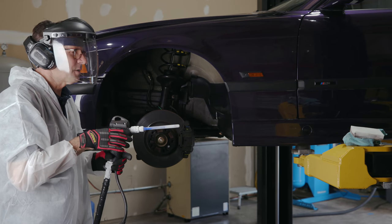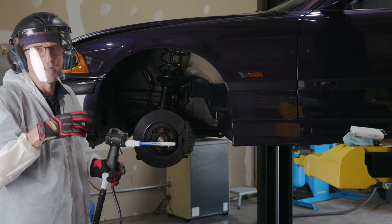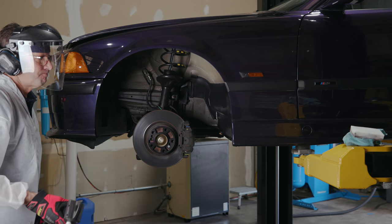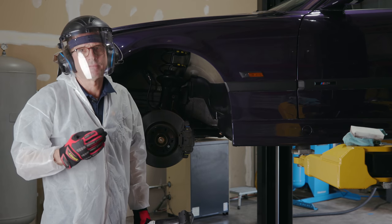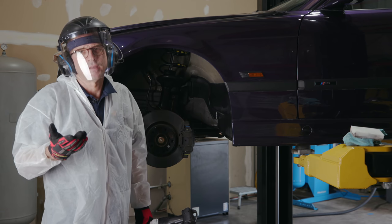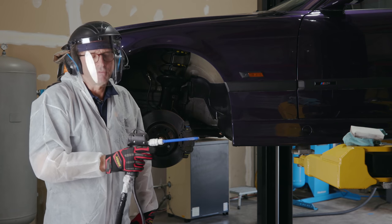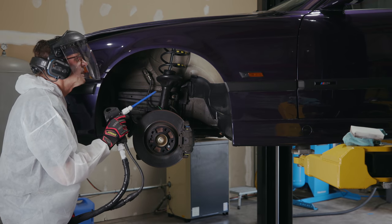So, a little weird. So I'm gonna turn my settings down to do this plastic liner, because these liners are pretty soft and I don't want them to look really weird. And what do I mean by weird? If the plastic is super soft, this is not an abrasive process, but it'll eat foam. It'll take foam right off. So yeah, it'll make plastic look gray instead of black or have a sheen to it. So we've had that challenge in the past. These are pretty low settings.